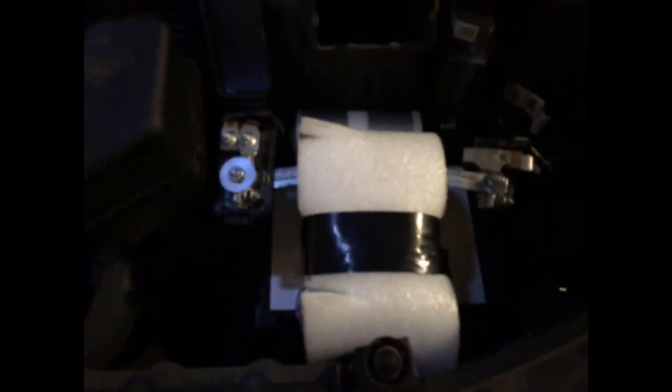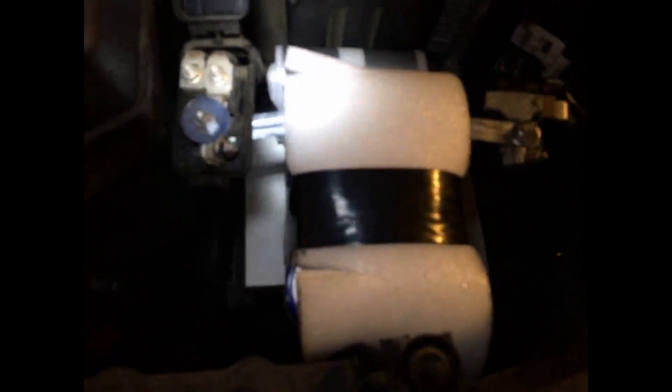I'm back, and you can see the cells are in there — this is just a temporary setup until I can get a battery case I find acceptable. The terminals are connected to the ultra capacitor posts. It doesn't look pretty, but it does work. I've driven it and it works great. I'm not really worried about parasitic loads because it takes a long time for a car clock and other things to really drain these ultra capacitors.